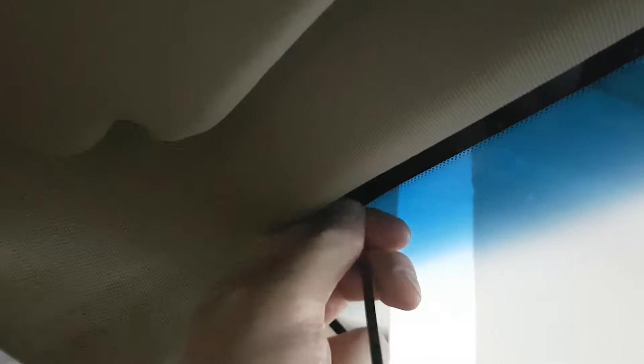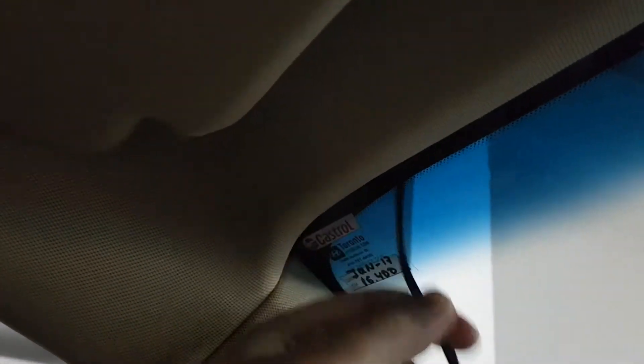The next step is pulling the cable under the roof lining. This is easily done because there is a gap between the roof and the windshield where the wire goes in nicely. Try to maintain a little bit of spare wire in there in case you need to change the camera position in the future. If you don't, you'll end up pulling and undoing the entire thing again. In some spots where the lining comes close to the surface, don't worry.